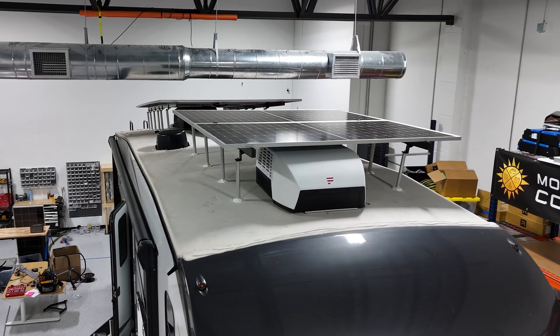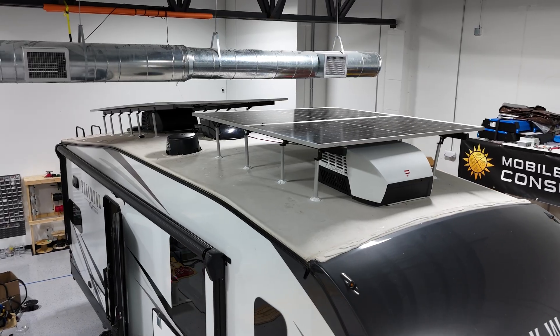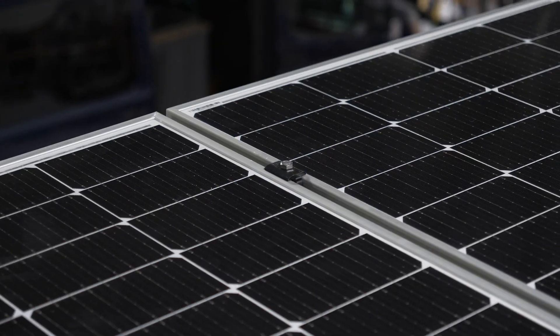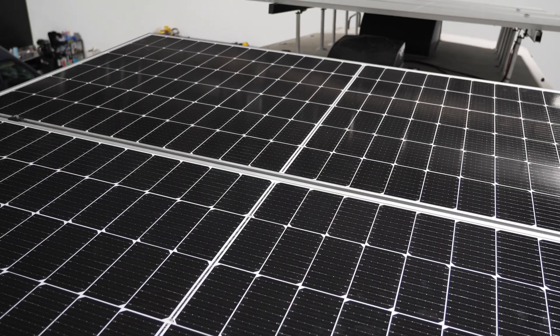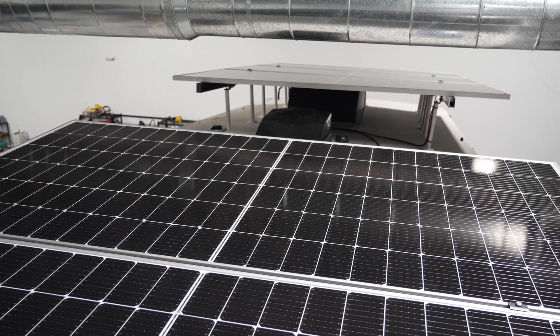There are multiple other benefits to having your whole roof covered in panels like this. Number one is that it's shading your roof, keeping your RV cool, and shading your air conditioners so they're going to operate at a higher efficiency. They're also protecting your roof's coating material and sealants from the constant beating of the sun and the rain. You can see the clamps holding the panels down in the middle, and there's a special clamp on the end — both unscrew with just an impact driver with a socket adapter. So it's super simple to remove a panel, move it to the side, service your air conditioner, or replace a broken panel without having to remove and replace sealant or open up holes in your roof.